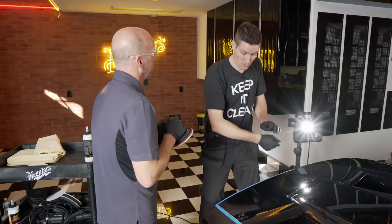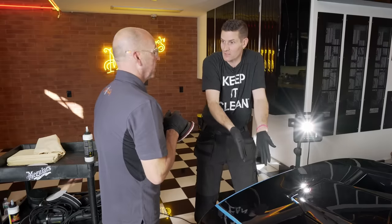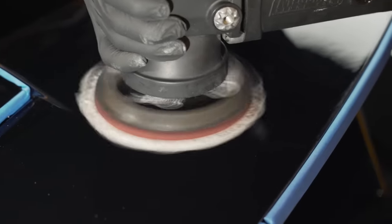That's actually a really good point, because when we're doing the mow down, there's so much liquid on there. It's fuzzy, it's blurry. You can't see the paint. So now when you're backing it down, you can really just go after those individually. And we have to always be aware, every pass, every rotation, we are removing paint permanently.